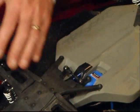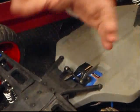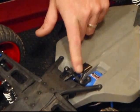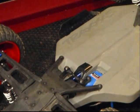You know, three quick tips to save you a lot of headaches. Threadlock the front. Get the electric tape on this. Keep the dirt out of the front of the shaft here. And kill these two drain holes. Don't need them, unless you're really, really going to be doing a lot of water driving.